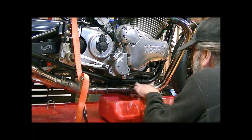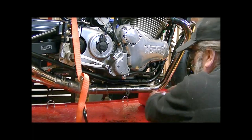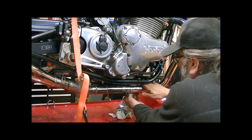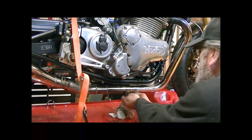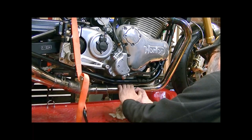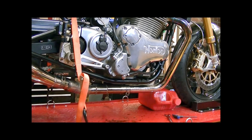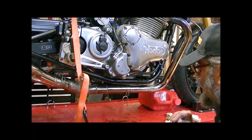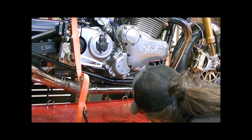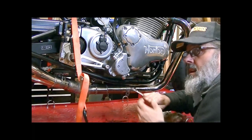This is a bit difficult to get to because of the exhaust in the way. The flange on the drain nut means that you can't thread it up between the exhaust, so you've got to sort of slide it along from the front to the back and then feel your way in there to get it lined up in the right place. I'm pinching that up with the spanner now - the official torque setting on this is 20 Nm, but I can't get the torque wrench in there so you just have to do it until it's tight.